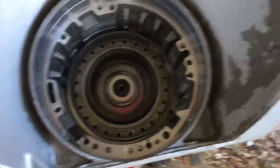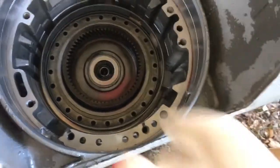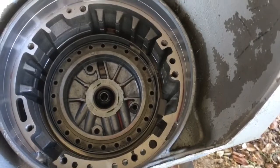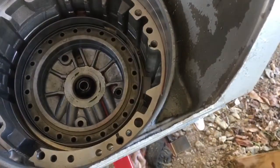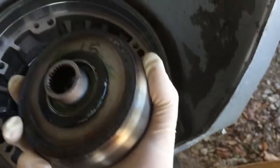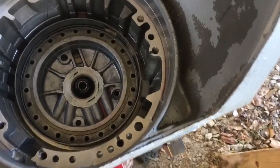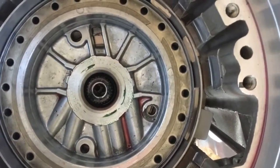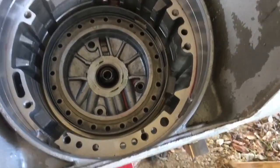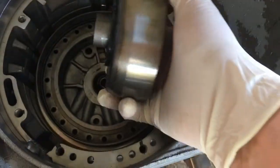As you look down here, you can actually see everything inside the transmission. Right now you're looking down into the fourth internal gear — this billet internal gear — just sitting in here. I'm going to pull this out, and there's the center support. This is the rollerized center support. We've got a roller bearing that came out on the back of the billet that actually sits right in there, so that's part of the rollerized system to help really decrease friction. This green stuff you see here is the assembly goo. If you look down, you can see that silver stuff in the relief holes of the center support — that's the forward drum, the piece that was so worn when I pulled everything apart. And we've got our fourth piston here already installed as well.